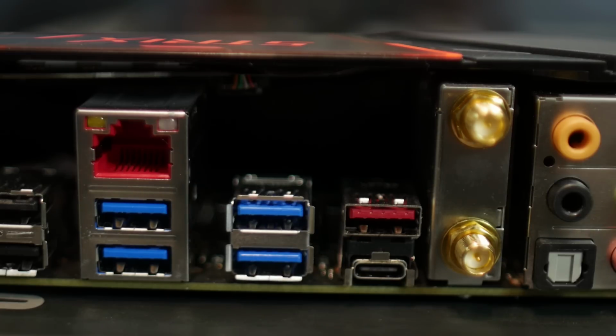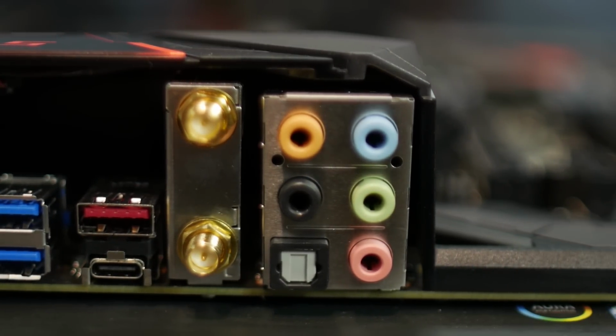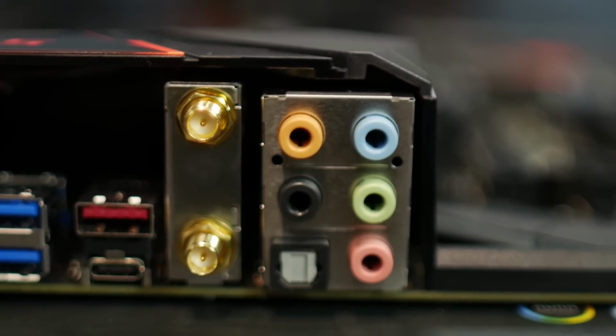Now, this is a really interesting setup here, too. One of these ports is wired into the Intel USB 3 controller provided as part of X99. You get 6 total. This motherboard implements 5 of the 6. The other 3 are through an ASMedia controller. So 3 of the 4 ports here are through an ASMedia USB 3.0 controller. The 4th one is through the Intel chipset. Then you've got your ASMedia USB 3.1 controller. You got one Type A port and one Type C. The Type C port provides up to 36 watts of power to use for quick charging a phone or whatever.